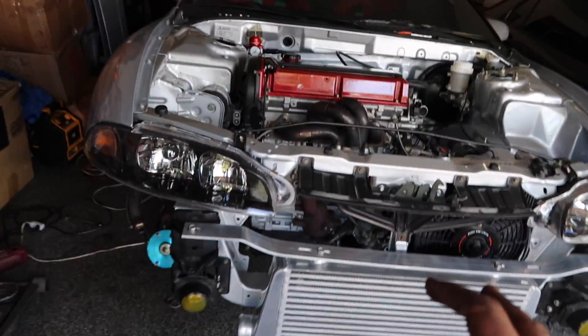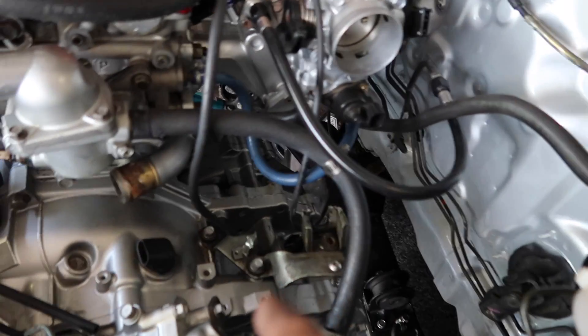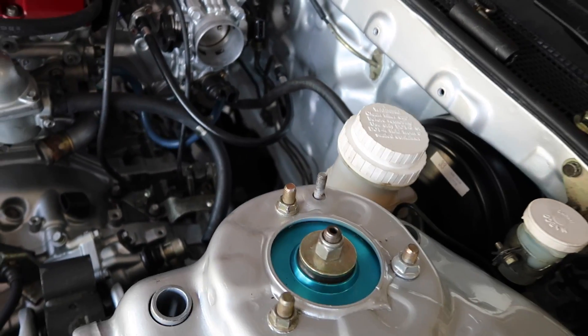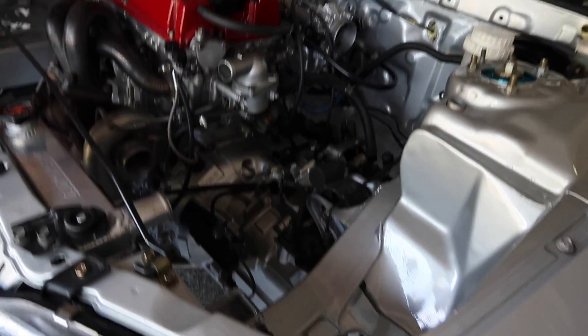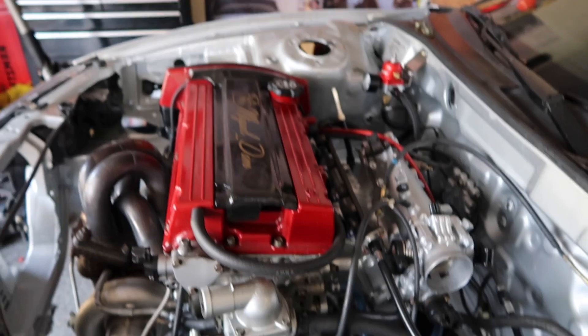We had to detach the coilover on this side, but as you guys can see we have nothing back here. So we did get a lot of progress done. We got the wiring harness out, which we're going to ship out either today or tomorrow. We removed the previous shift linkages, tried to see if the EVO 4 ones will fit — which they will not — so we'll have to figure that out. And we dropped the complete subframe. Now we'll actually be able to reinforce it, hopefully in the next episode or so. Progress is progress. This is why we're going to need a rear motor mount — because once you're pushing power it's just going to snap, and we don't want that. Really happy with the progress today. Hopefully you guys enjoyed the video — like, comment, subscribe, and I'll see you then.